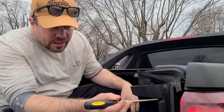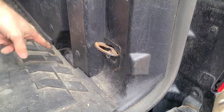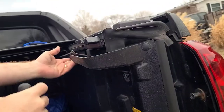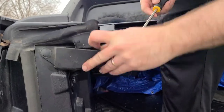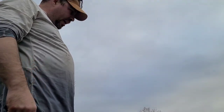This one - water goes into here and just drops out on the bottom. Then you have a drain right in the bottom of your bed. Make sure that's not clogged - it's like a flip-type drain. There's one like that up front. This goes into a drain mostly here, but I believe there's a hole up front too, just in case the water goes both ways. At least that panel got a new lock so it holds tight and much less water will get in there.